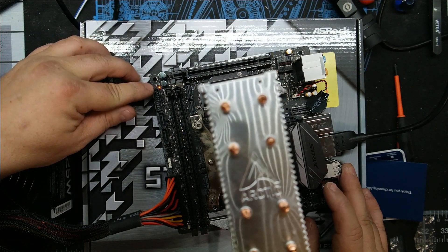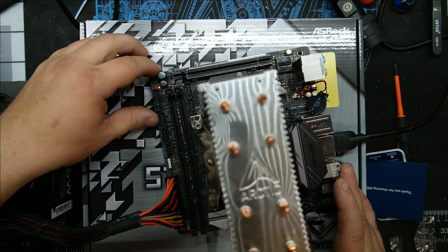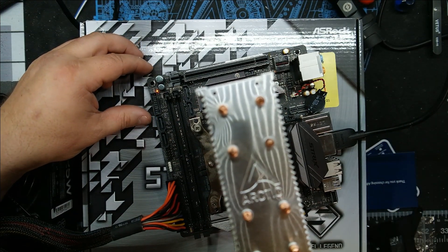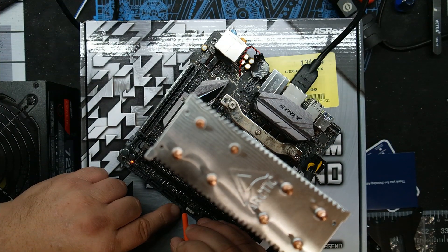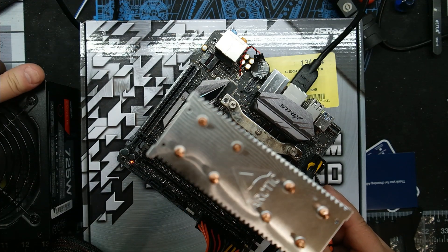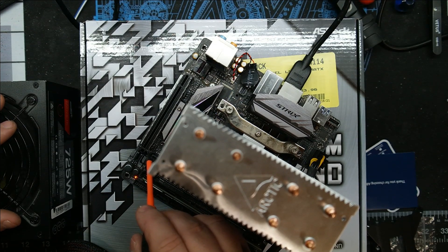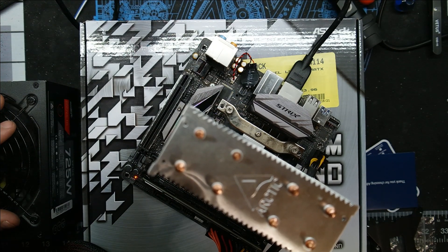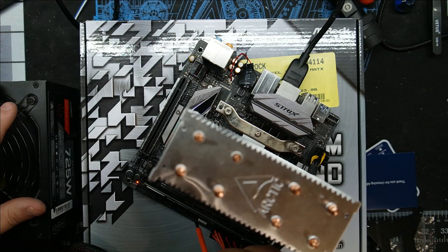We get a nice little orange light right here and we're pulling 45 watts right now, but I have no bottom lights and no screen. Let's see if we can short the pins and turn this thing on. LED, reset, hard drive, power — power's over here. Nope, no power difference, no screen. Oh yeah, duh — cutting the RAM in. Something's responding, because this is the clear CMOS right here, and if I touch it, it immediately kills off the power. As soon as I release it, it wakes back up. But we're back to pulling 40 watts, not doing anything, no display, no bottom lights, and it won't respond to a manual shutdown.